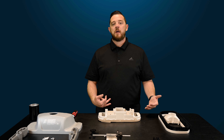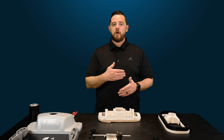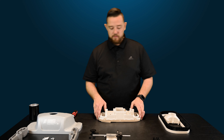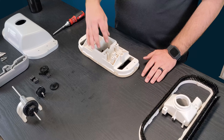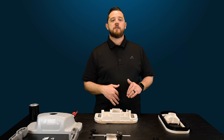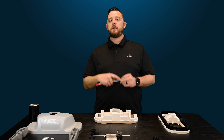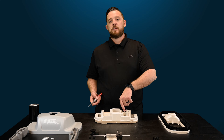So depending on what your suction is set at, it could happen more often than not. It is part of the gearing assembly that the oscillator is attached with to make this actually operate. So you will need to remove the two gears that sit in front here with a small screw. Again, we've got videos in the description for you guys on how to remove that — it just makes this process a little easier so you're not having to work around those gears. And then you will need either some kind of a stick or a screwdriver, something pointy that can actually get into the small orifice on the side where you'll actually see a spring.